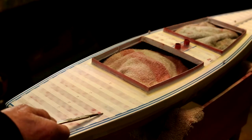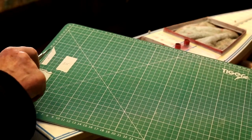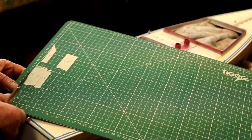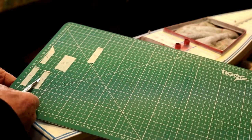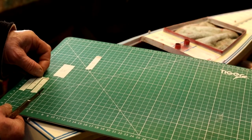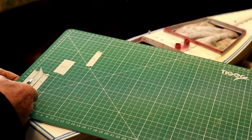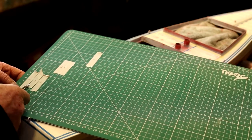I've got some 25 millimetre tape and I've cut it into 12 millimetre and 13 millimetre pieces, so I have a 12mm, 12mm, and a 13mm in between. When you take away the 13 millimetre piece, you then have a 13 millimetre gap. You can then cut some 12 or 12.5 millimetre tape, and once you've sprayed it, put that over. It's important to try and keep it actually on the red and leave a tiny bit of red either side, so that when you do the second spray you'll get a slight overlap on the red part.